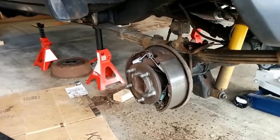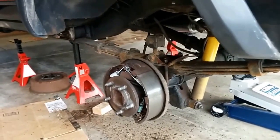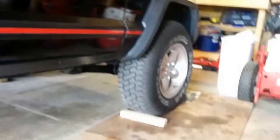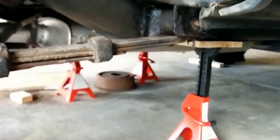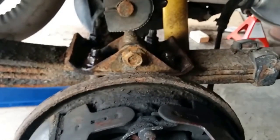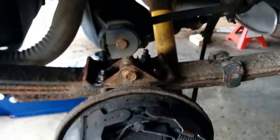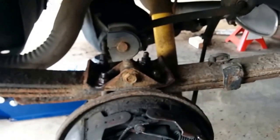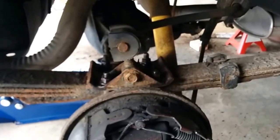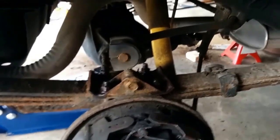What I'm going to do, as unexciting as it is, is start tearing into the other side. I don't want to get one side done and find out I can't do the other, so I'm going to start loosening up stuff there. Luckily I pretty much followed the same techniques as I did on the other side and worked everything out. The U-bolts on this side were a little worse so it took a few more minutes — wire brushed them, wire wheeled them. That way I could hit them with some oil and try to get some of it in there, hit them with heat, hit them with oil, hit them with heat. And then just used a breaker bar with the 18 millimeter deep well. Took it real easy with them at first and they started moving. So we're good there.